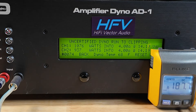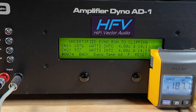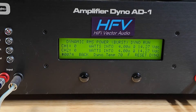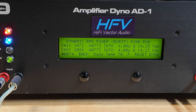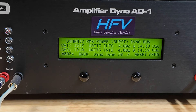1076 and 937 watts — this thing's putting out some juice. You can definitely use this to power a couple subs and give each one about a thousand watts. Last test of the day: dynamic burst on 2-channel mode at 4 ohms. 1200 watts dynamic — you can definitely run two subs off that at 4 ohms each. That's decent enough power for daily driver subs.